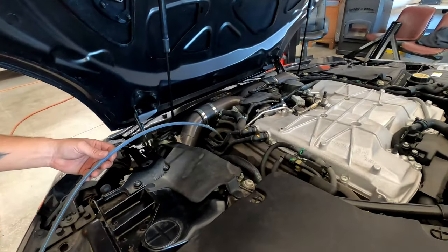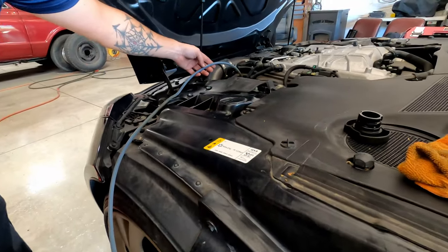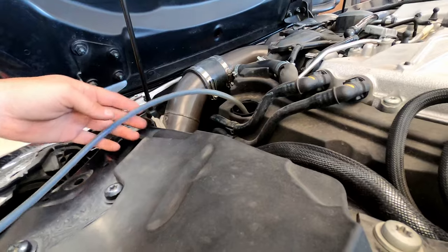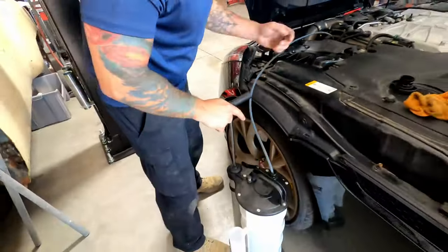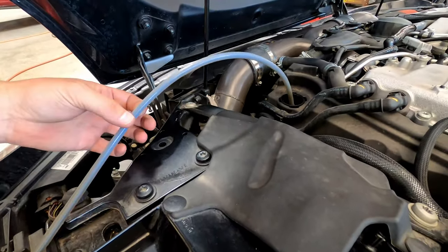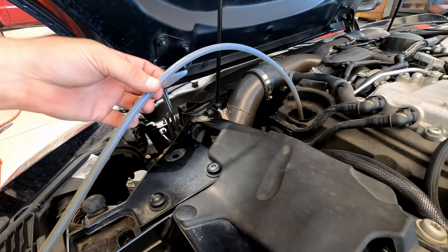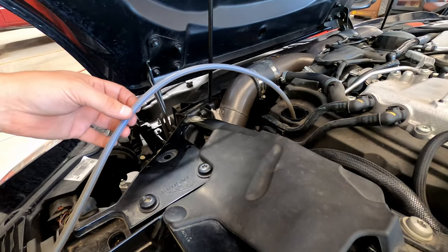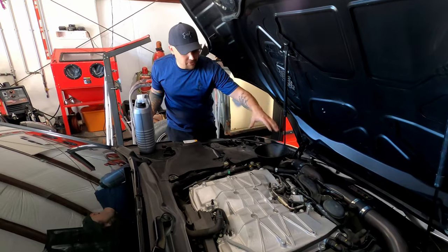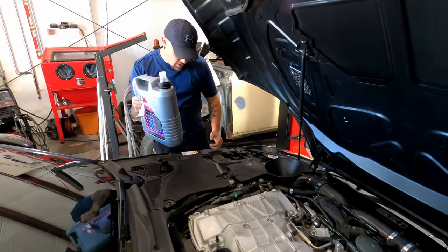What you're going to look for when it's done is air traveling through this hose — that'll let you know the oil pan is empty. Right now we still have a pretty steady stream, but we should be getting really close. There it goes — you can see it, you can hear it. It's shaking. Now it's starting to pull air, which means the bottom's empty. I like to give it a couple more good pumps just to make sure I get all the oil from the bottom. Let that pressure finish and then we'll get to filling it. Find yourself a funnel — don't worry if the funnel goes around the straw because the straw leads right back down to the oil pan, so the oil is all going to go in the same place.